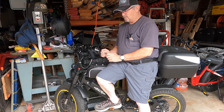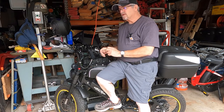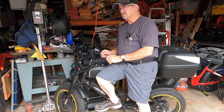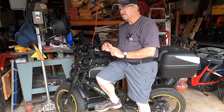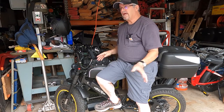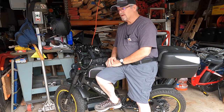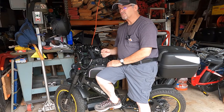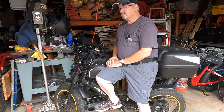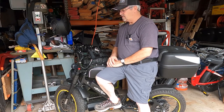It was kind of weird though that I could wiggle a wire and it would quit, and I'd go, okay, that's it, it's right there. Then I'd take that apart and fix that, and then it doesn't work at all. Then I wiggle the wire on the battery, and it was like, okay, it's the bad wire on the battery, and I change that, and then dead, nothing. Get my multimeter out, test the battery. Yeah, I got power coming out of the battery. I got power coming out of the wires where it plugs into the battery. I got power everywhere. Nothing's working. Connect the two wires for the switch, the light comes on. Really? I got a bad switch.